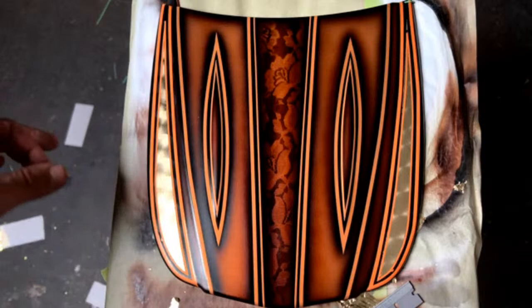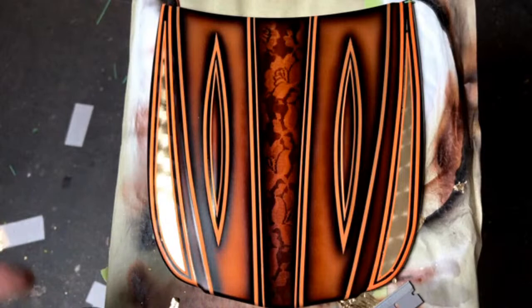So yeah, this would be ready for clear coat. Like I said, we spun this right after, no waiting on the spin, virtually no waiting on the glue. If it's applied right. If it's oversaturated, it's going to take a long time to dry. Usually you left a lot of texture on there. If you do leave a little bit of texture, re-leaf it again. A lot of the stuff where I want it to be 100% perfect, I'll leaf it two times, because it's just easier that way. Sometimes you have to leaf it twice anyways when it comes to that.